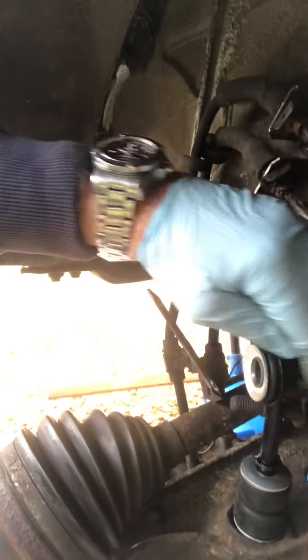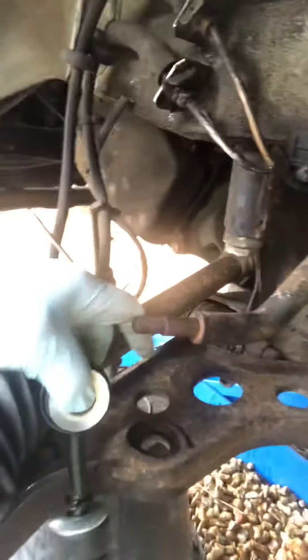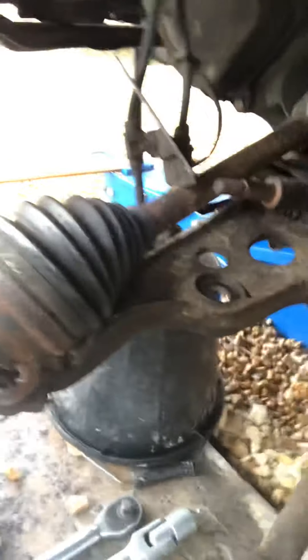You've got to be creative on these things. It didn't work for this side at all, despite heating it up and setting fire to the rubber, which you can just flap out with your gloved hand. So what I did, I used an angle grinder and I cut through from the side right through to the sleeve — I didn't want to damage the shaft on the roll bar obviously. So all that was left was the inner sleeve on the end. I was able to get a mole wrench and slide the inner sleeve backwards and forwards, and sure enough it came off. So that was last night.